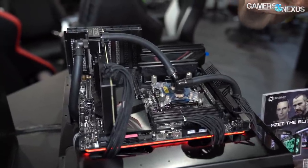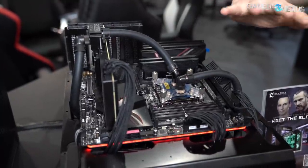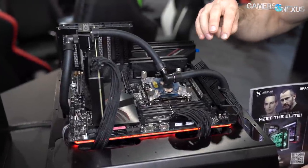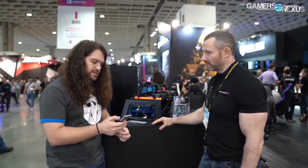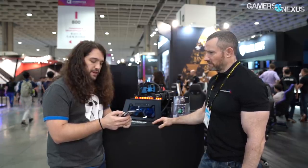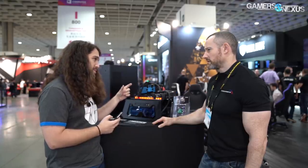So for that — is it like you just pull a couple of screws out and swap the plates? Yes, you just undo the four Allen bolts on the bottom, open the block, put in the new impingement plate, and reassemble the block. So the direct IHS and direct die contact options — direct die everyone knows: you delid the die and cool it directly. Let's do direct IHS first because that's a bit different.